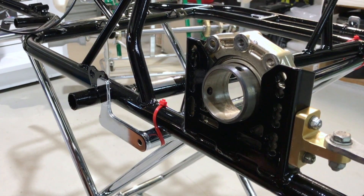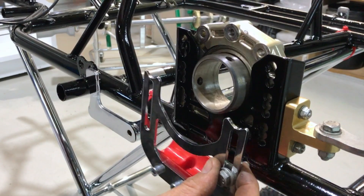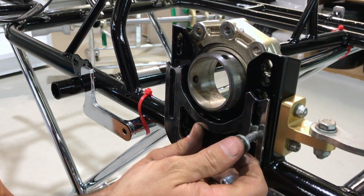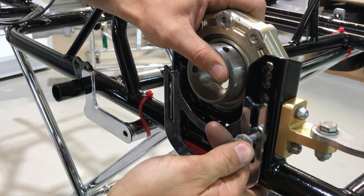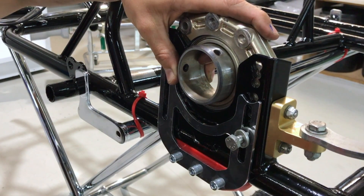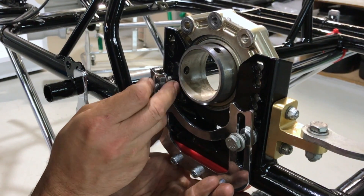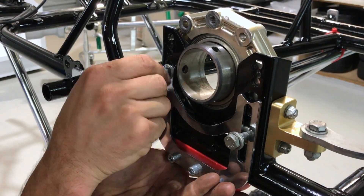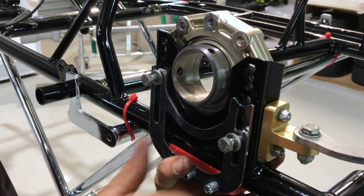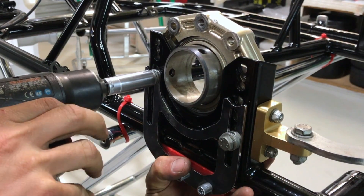We're going to install the chassis protector on this side. You have a washer, then the bracket, and then another washer on the inside, so it is a little bit tricky to get them in. I'll show you a little shortcut — just go up to the third hole, chuck it in there. You run out of hands pretty easy. This will slip around a bit, but just pull the bearing up and jiggle that in there. Then just lightly do those up.